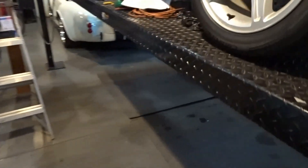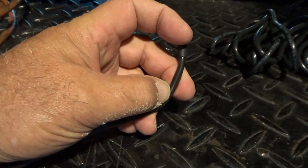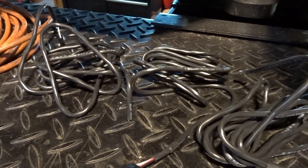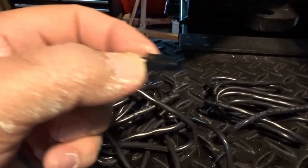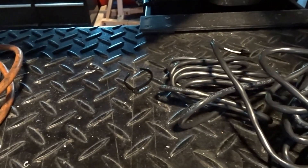One other tip I wanted to share: the cutoffs you're going to have from the Speedhut wiring harness — if nothing else, save these ends. What I always do for the car owners is cut off a piece from the connector back about 12 inches long. I've got one, two, three — two different types here, a three-wire and two two-wire connectors — and I just put them in the gauge box. That way, if at any point they are having to repair or replace the gauges, these clips are actually kind of fragile. I've had one where the clip portion broke off — it'll go in but it won't necessarily stay. By having a couple of these extras, you can take the cutoff, solder it on, and then you've got a brand new connector on the end. I would urge you to do the same.